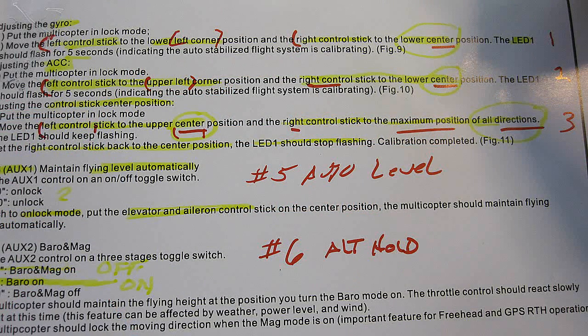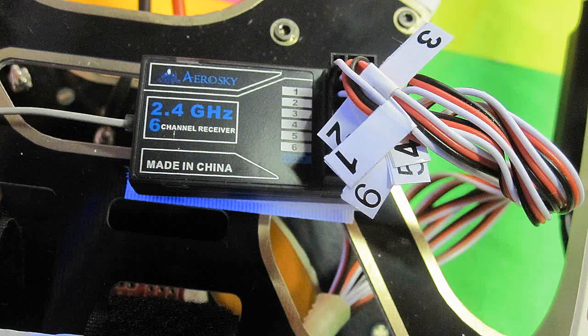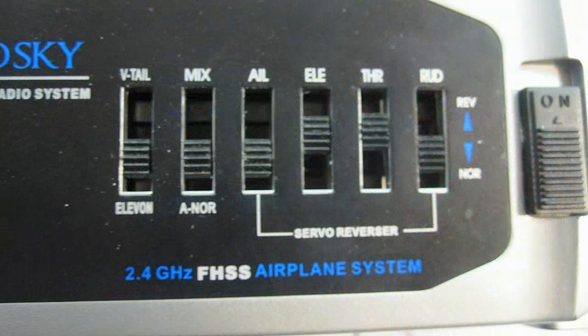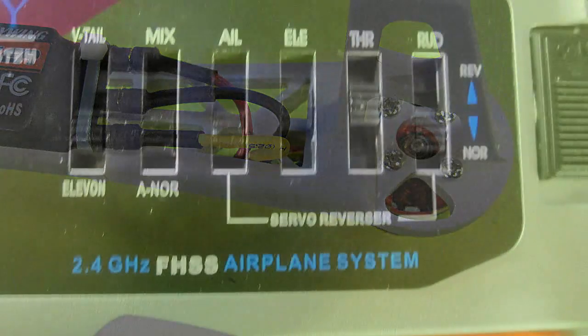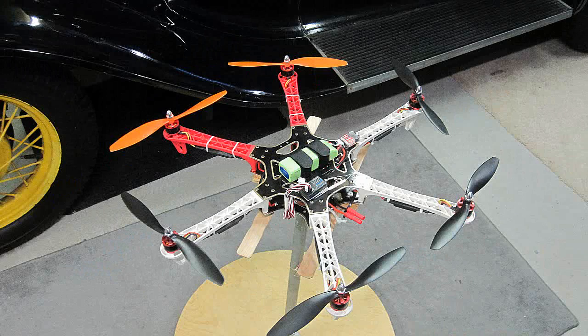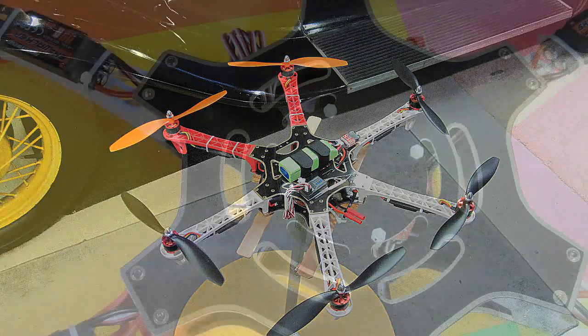It's important to note that this is the ready-to-fly version, and you're going to need to set up your transmitter first. That only means you must put the switches in the right reversing or normal position, or it's going to flip over and die on your first try, like instantly. Here I'm showing how the switches have to be set, because the manual is wrong. Also, if I did not have my helicopter test stand, I would have killed it instantly too — it was the only way I could figure out what was wrong and how to fly it.